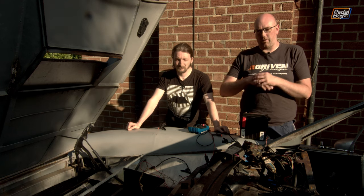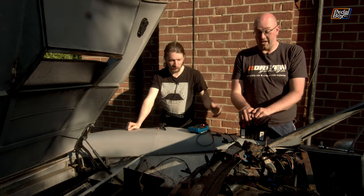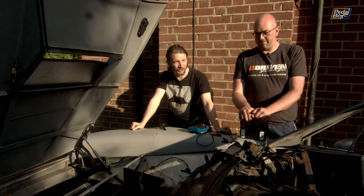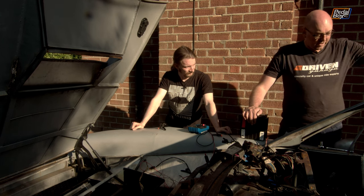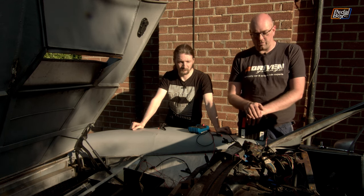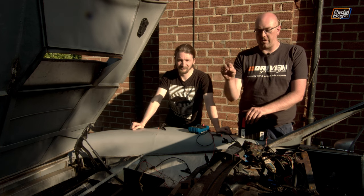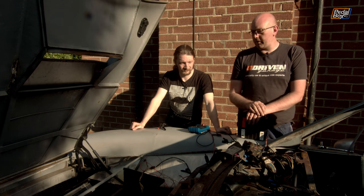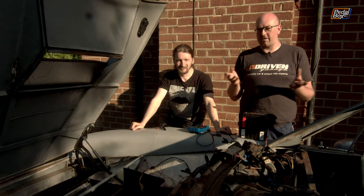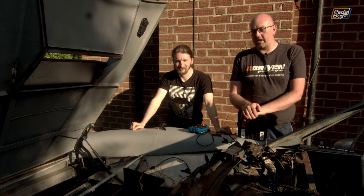It's also an engine bay — it's meant to get wet — so all the wiring in there is pretty well weather-hardened, whereas this interior stuff isn't, which is where the worry was. This is also where most of the modifications are. With the engine loom we really just cut and extended it, and when we did we validated every cable end, so that should all be fine. Next time we won't be starting it because we still have more wiring work to do: we need to chop some stuff for the fuel pump, plumb in the fan switch for the heater, and put a new plug on one of the fans — because we have two small fans whereas normally there's one big and one small, and they have two different plugs. We also need to think about bypassing the fan control module, which is renowned for its failure.